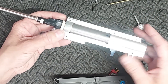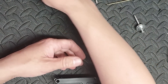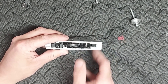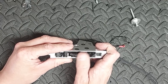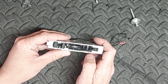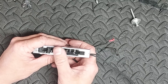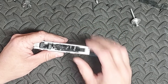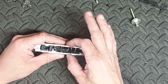This had splayed open. It's CNC'd aluminium — meant to be decent quality — shouldn't do that. That is a perfectly shimmed gearbox with no movement left or right on any of the gears — it is absolutely perfect, turns nicely. So here's what happens: you have to under-shim this part of the gearbox. You've got no choice — you have to under-shim it, because when you clamp it closed there's flex in this part of the gearbox casing.